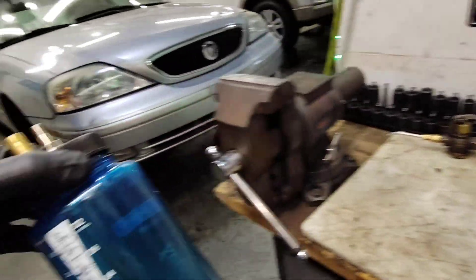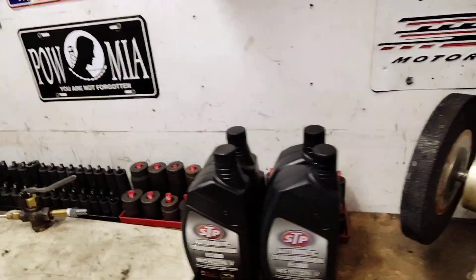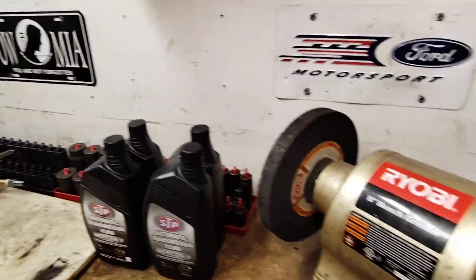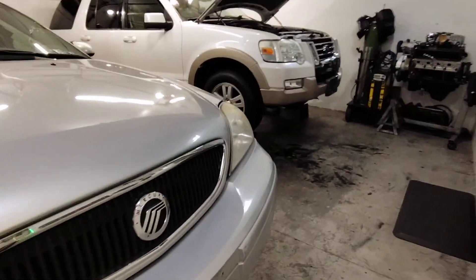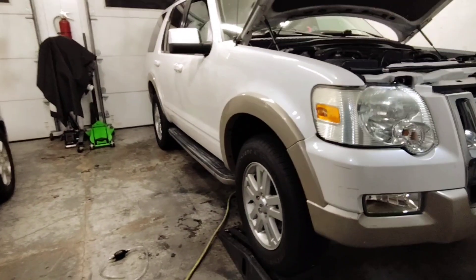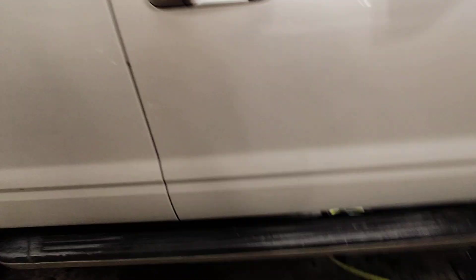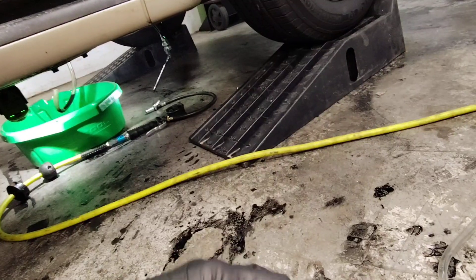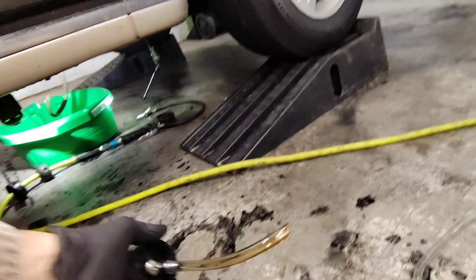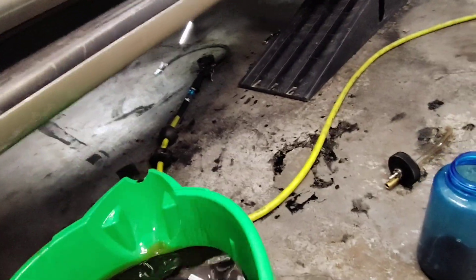With this Explorer, the reason I'm doing what I'm doing is because I didn't feel confident putting Mercon V in there fresh, because this vehicle has like 200,000 miles. It has the factory gasket on the transmission pan when I pulled it, and the fluid reeks and it's black. I don't want Tiffany to have a vehicle that doesn't shift once she comes to pick it up.